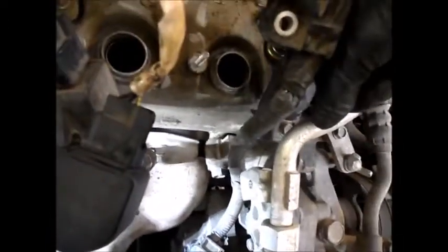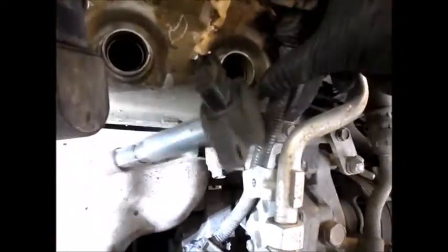Okay, so if we just pull all the spark plug things out, get this loose like this. Unclip the alternator wire from this clip right here, and then undo the alternator connections. Make sure you've disconnected the battery negative terminal before you do any of this, of course. Oh, it's clipped to the alternator somehow, so you have to figure that one out.